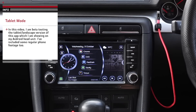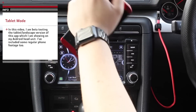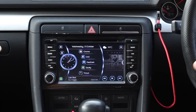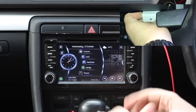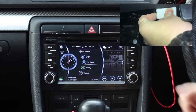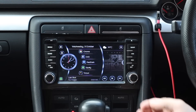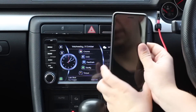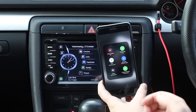In order for this OBD11 device to work, we need to follow a few steps. Whichever phone or tablet you're using, you need to make sure it has an active data connection, because OBD11 requires a data connection to perform all its scans and functions properly — which is one of the major setbacks. So you need to either connect to Wi-Fi, have an active data plan on your SIM, or, like I tend to do on my iPhone, just open a personal hotspot and connect that way.